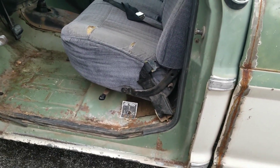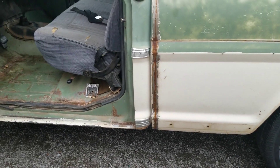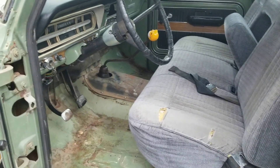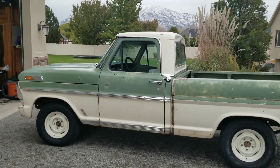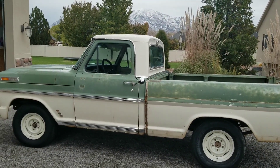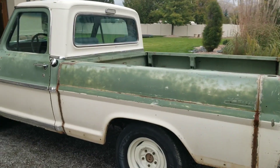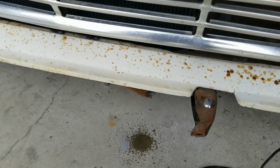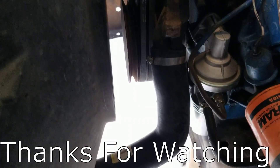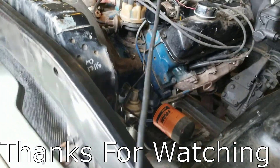Overall I think the bones are good. I have some trim and the original seat. It's a good candidate to clean up and fix up. Old trucks built up for sale — I know I've already mentioned that. Side note: looks like we have an antifreeze leak coming off a hose down in there — might be originating from up top. Hopefully it's not the water pump, but something's up. Put that on the list to check out.